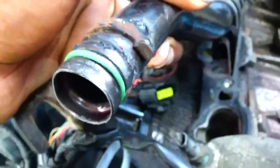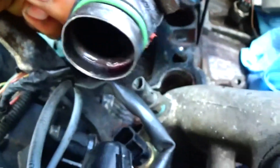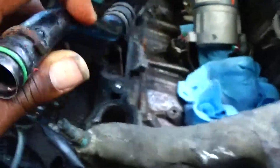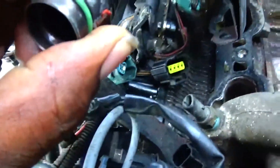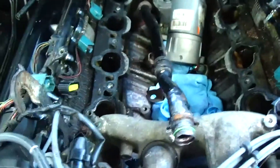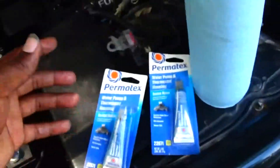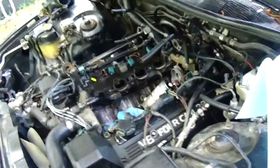I don't know how this pipe was made or what this metal thing is. I thought I had to put an O-ring on it because this thing was compacted with water pump gasket maker and everything. I think I see why they did it — there's some type of dent at the bottom. Camera ain't going to pick it up, but there's a dent at the bottom somewhere. I hate working behind people who already did this job before I did. So now I have to regretfully repack this with water pump gasket maker. I don't have access to go to a junkyard right now because your boy is broke. I'm going to go ahead and do that real quick — put this pipe back in and try to compact it a little bit more.